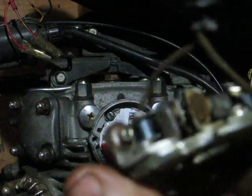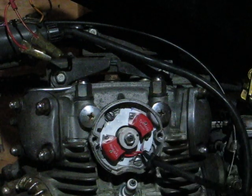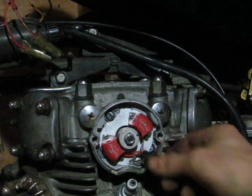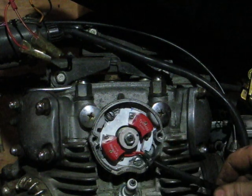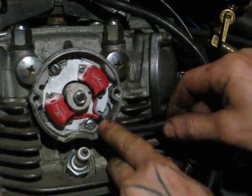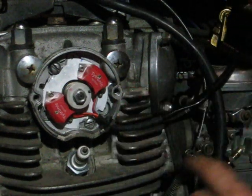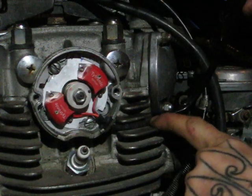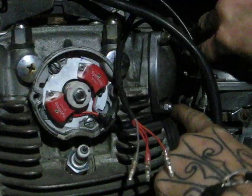Now there's this little grommet right there on your points wiring. If you only have one set, you can steal it off of there. I had an extra set, so I took the grommet, sliced a cut in it right along the flat side, and spread it and put it over the Tytronics wiring. You push that little grommet into the cam cover, and you can run your wiring exactly like the factory wiring was run. In between the fin on the top of the head, below the fin on the rocker box, around the back side of the left side intake valve cover, and up towards the coils.